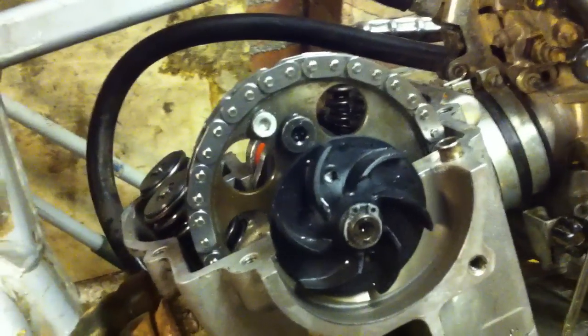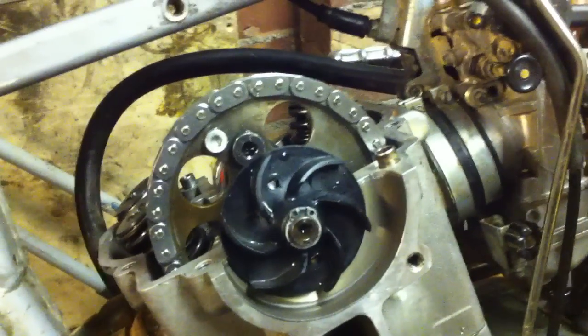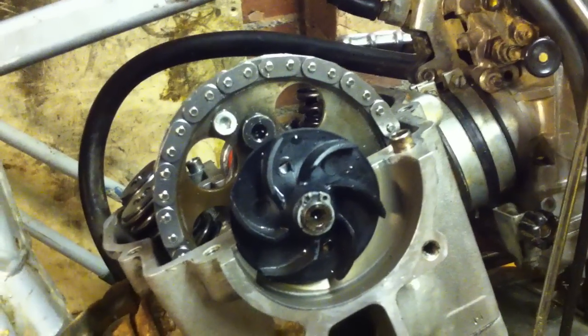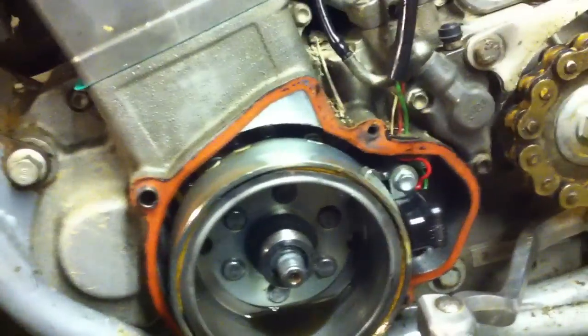This is not possible. Trust me, I've tried. The chain has to be broken and re-riveted any time you want to take the top cam out, because there is no movement. At this moment in time, the engine is locked in place and she is set at top dead. As you notice, the cam chain tensioner has been removed and the chain is as slack as it will ever be.